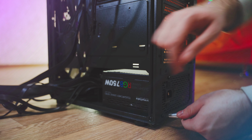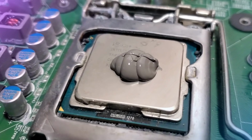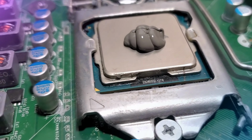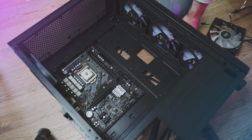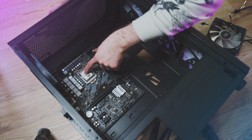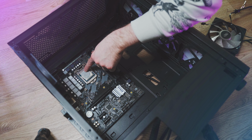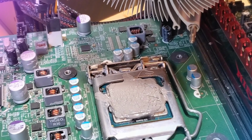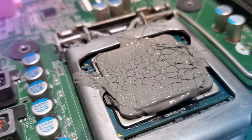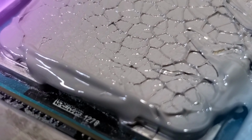Enjoy the build process. Excess thermal paste. Generosity is more a good thing than a bad thing. However, everything should be in moderation. Thermal paste on a processor or a graphics card chip is the best example. Just a few drops, evenly spread throughout the lid, and that's it. Thermal paste is needed for tight contact of the processor cover with the cooler to fill micro cracks, and excess paste will not improve thermal conductivity in any way, and paste pieces throughout the motherboard will definitely not benefit it.